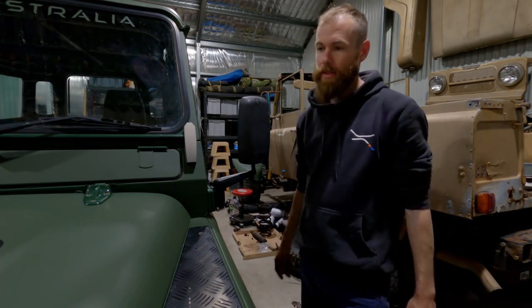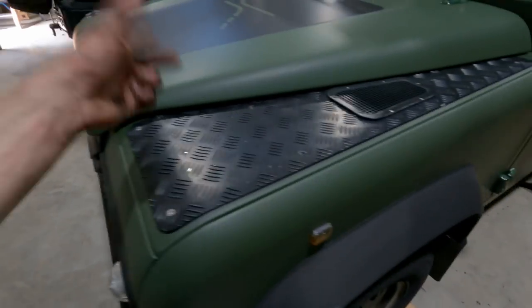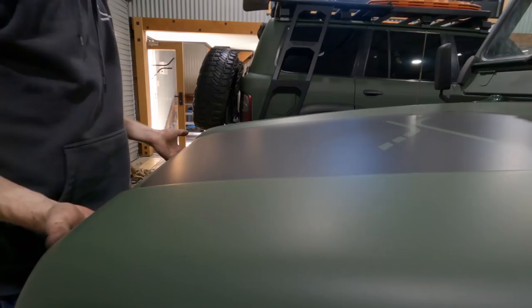I'm going to get the front in. Front might be more trouble than the rear, not sure. Anyway, we have the 2.0s from Superior to go in the front. Pop the bonnet, expose the top of the tower from inside, jack it up, start undoing some bolts, I guess.